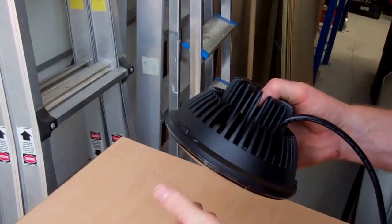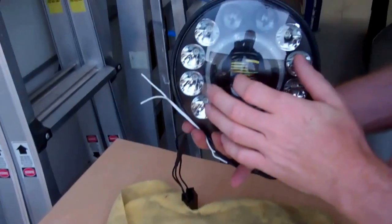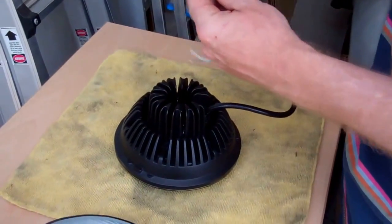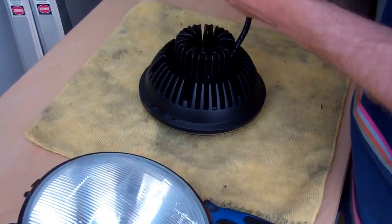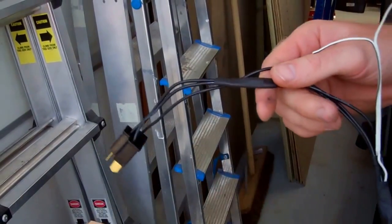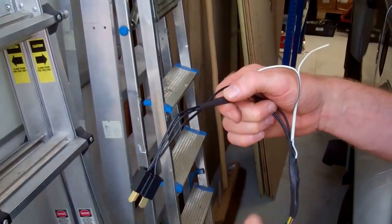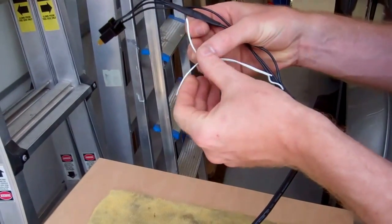Out the rear — avoid putting it down. These headlights have got a plastic lens and it is scratch resistant, but even so I like to treat it with respect. These come originally with just four wires, and on the website we've put the colour connections. We've put a diode inline here so that when you're on dip beam only the dip beam comes on, but when you go main beam you get the dip and main beam on, which gives you a really good light output.